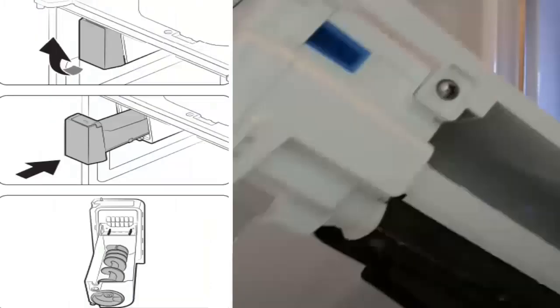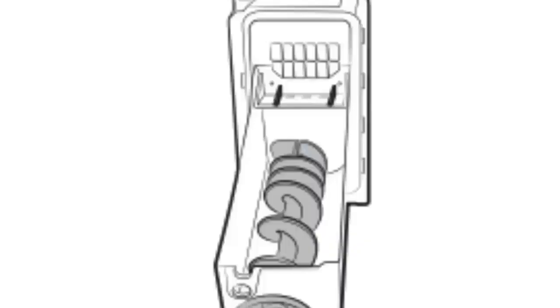4. Next, remove the ice maker from its compartment. Clear any remaining ice inside the ice maker to facilitate complete disassembly. 5. Check if the internal defrost system and mechanical components rotate correctly or if they're still blocked by ice.